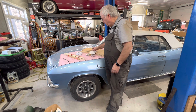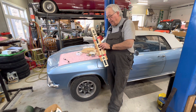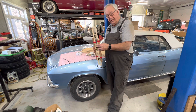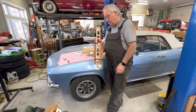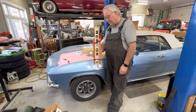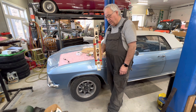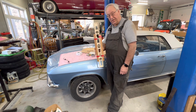Now back to the camber. I use just a regular level for camber, but I basically gave up on that. It's okay to get to level, but the problem is as soon as it's out of level, you have no idea whether you're talking a half a degree or 10 degrees. All you know is when it gets leveled, it's zero — that's about all you know with a regular level.